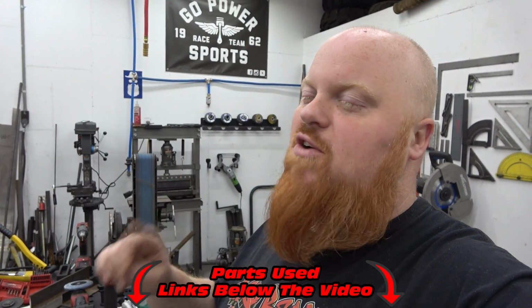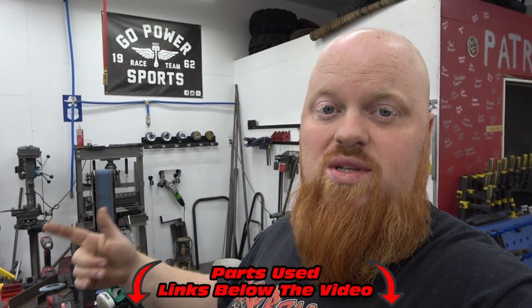This thing's going to be a certified ripper. Next episode, we're going to be throwing on a set of 26 inch tires, and probably tuning that lower pulley. It definitely needs a heavier spring in it. What we were finding out with that lower pulley is it's revving to its max RPM too fast, so it needs a heavier spring in it to hold that belt from riding up so quickly. So we'll get that tuned out very soon. We'll order some springs to play with. Let us know what you think about this Kandi cart. It is a certified little side-by-side. Aubrey's going to have a blast. We'll get the high or the low fixed in it very soon.